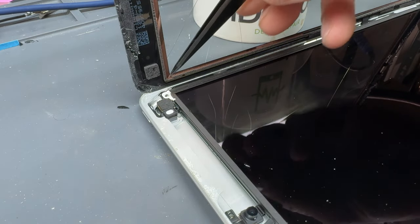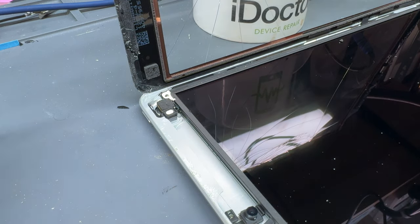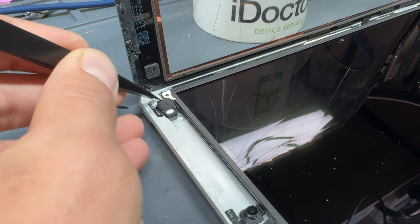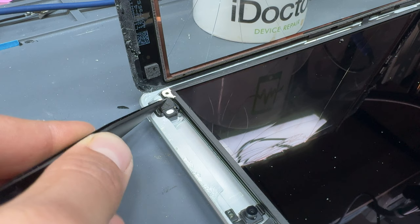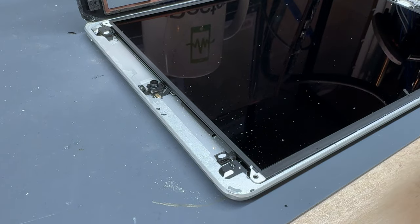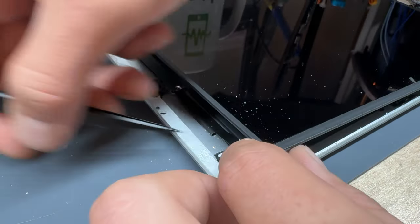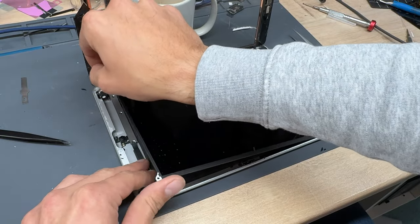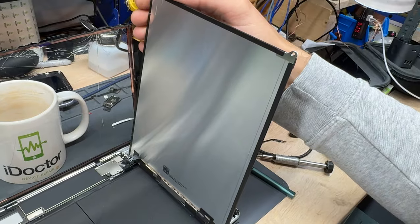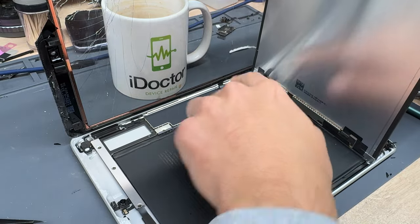Now that the LCD is almost free, there is some glue holding down the corners of the LCD. The easiest way to free this is by using tweezers and prying upwards on the plastic lug in the corner of the LCD. Take your time doing this because you don't want to break the LCD. You only need to pry up on the two top lugs — once that's released we can just lift up the LCD, which is connected at the bottom. Just give it a little wiggle and stand it up like that. You need a bit of dexterity here because you'll be holding the LCD in one hand and unscrewing with the other.